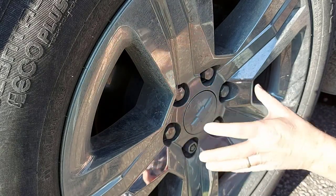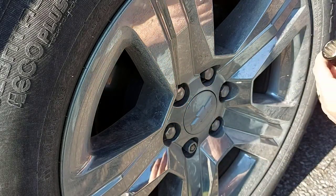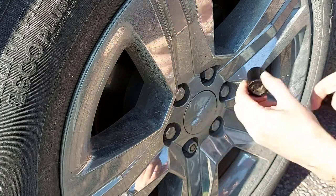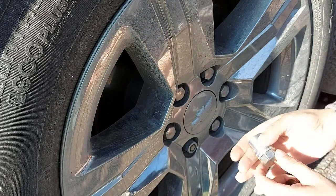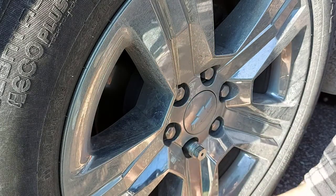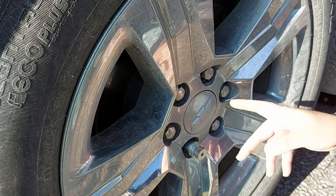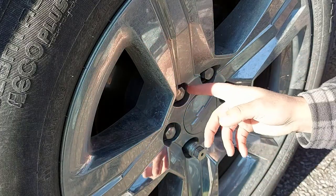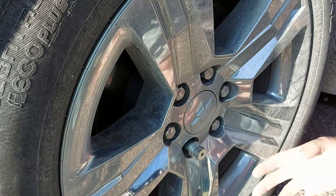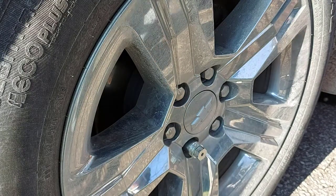Be careful with those plastic covers — all you need is a star or cross wrench to back off those plastic nuts and take the wheel cover off to expose your actual lug nuts underneath. I have 22-millimeter lug nuts on here, so I'll be using a 22-millimeter socket to remove them. There's also a locking one for theft deterrent. I'm going to loosen these off before jacking up the vehicle, because if it's raised too high and you go to undo them with a cross wrench, the wheel will just spin. With an impact gun they'll come off anyway, but I'll show you the safe way just in case.